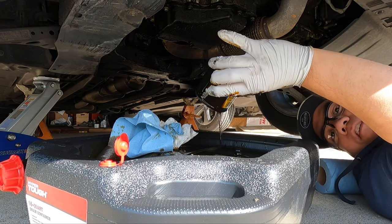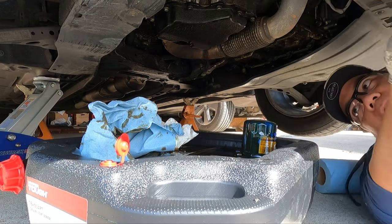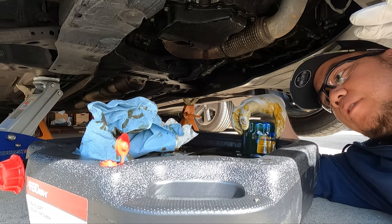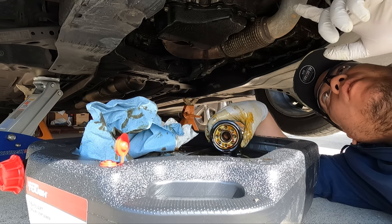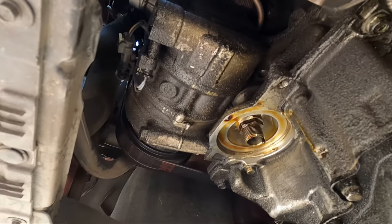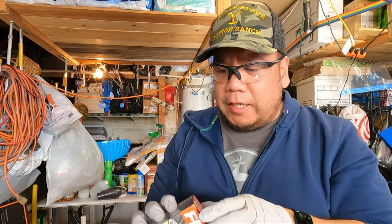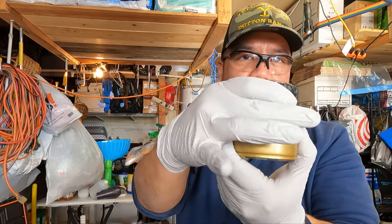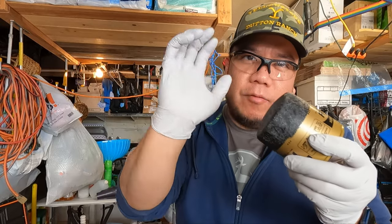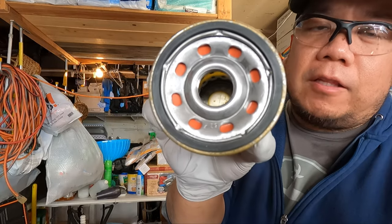As we see, there's still quite a bit of oil left — we'll let that continue to drain a bit longer. So when it comes to this oil filter, there is a gasket. I've never experienced it, but sometimes the gasket can get stuck onto the actual engine. We see here the gasket is still here, so we are good to go. See the filter right here — it screws up right there, and then oil comes in and flows out of the holes in the filter back into the engine. This is a Fram UltraGuard. What's cool about the Fram's is they have this grip tape at the end so you can really get a nice grip, which makes it a little bit easier to grab. The holes here — goes in dirty, comes out clean-ish.